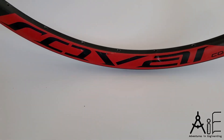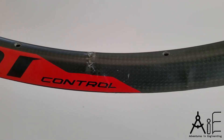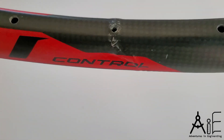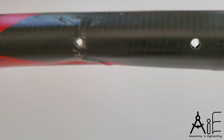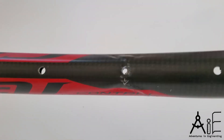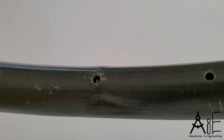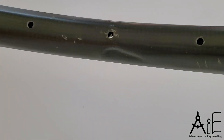I'll start by saying I did not have a catastrophic failure in this wheel — no body over the bars, no broken bones, no anarchy involved. My carbon fiber rim developed a series of several cracks and I deemed it was likely to break if stressed hard enough. My first clue that something was wrong was when a spoke nipple broke, but it happened when a stick hit the spoke. Over time, four more nipples broke in different circumstances, so that got my attention.